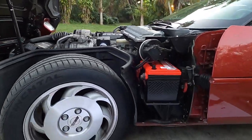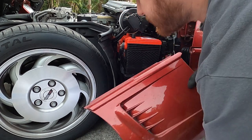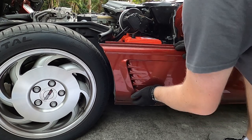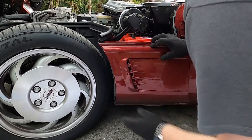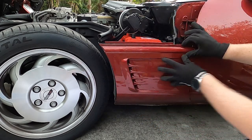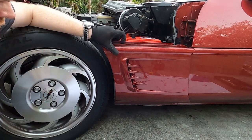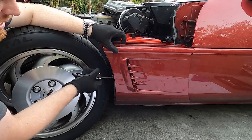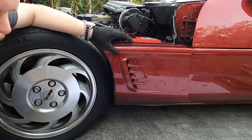Let's go ahead and get the panels back on while the car is running so it's charging up the battery at the same time. Assuming the alternator is also working properly, this car should charge up and be back to normal in no time. My recommendation is to do the three bolts first while the wheels still turn, and then you can worry about tightening and aligning it with the door panel. Because of the flexible nature of all this, you want to just snug everything — don't over-tighten. I'm leaving it slightly loose so I can still move everything around while keeping it secure.